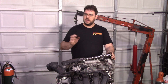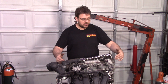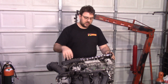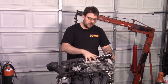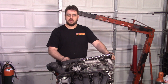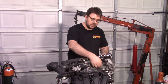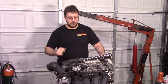That puts the intake cam back into the factory position it holds in the hybrid motor, which means the cam position sensor will read the correct position. There's a real chance we can drop a lot of cost out of this particular build and still make 250 to 260 wheel horsepower — that's speculation until I do it, but it's one of the next configurations I'm going to try. Essentially you're just using a second intake cam from the FXE in the exhaust position, without mucking with the cam tower, valve cover, or potentially even an aftermarket ECU.